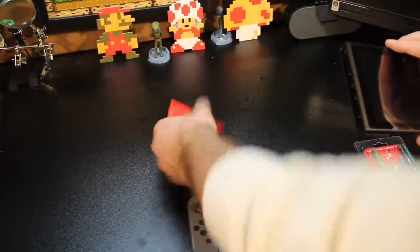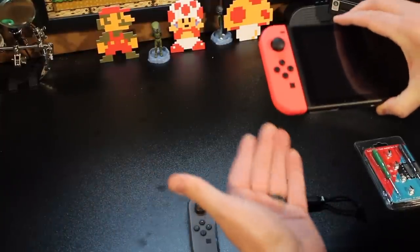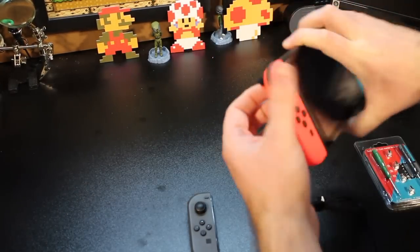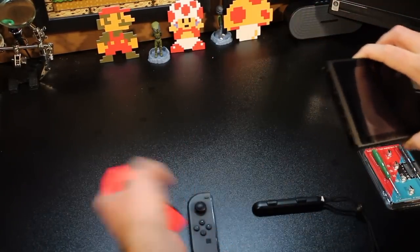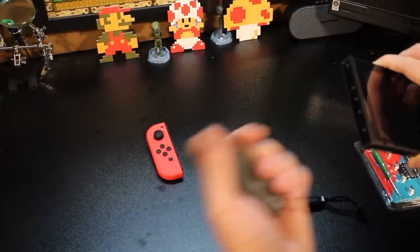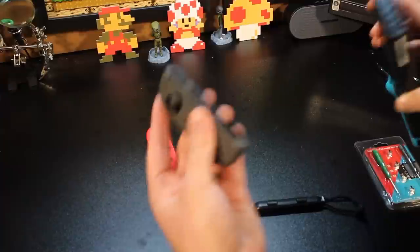Just like that on my Nintendo Switch, when I slide it into place, it comes right off. I could actually just tap it and it pops right off — I don't have to press the button. This one's pretty bad. Whereas this one here, when I slide it into place, it's in there nice and tight. And in order to get it off, I have to press the little button on the back — it releases it and comes right off. This Joy-Con still works; the only problem is that little latch, and that little latch needs to sit right in here.